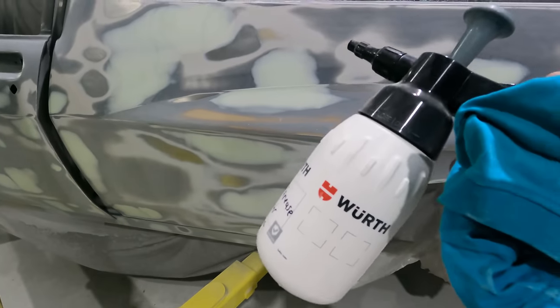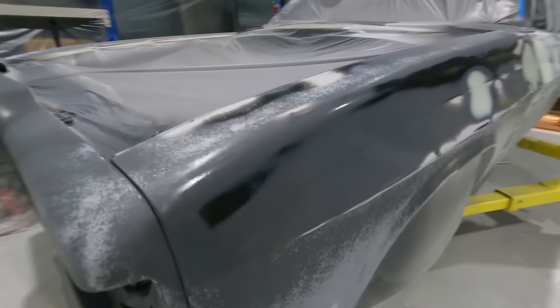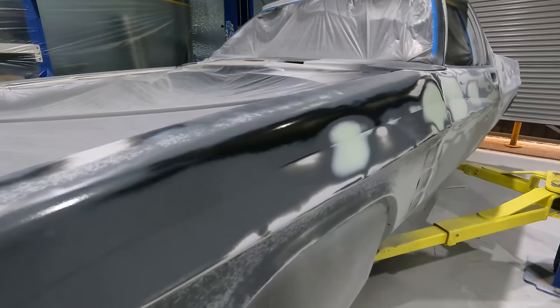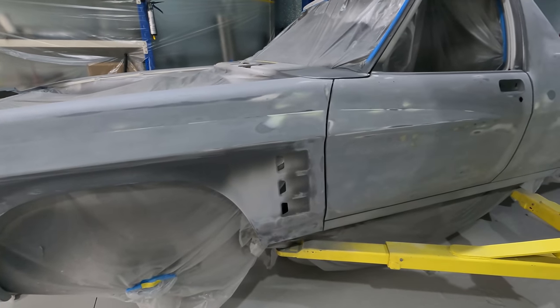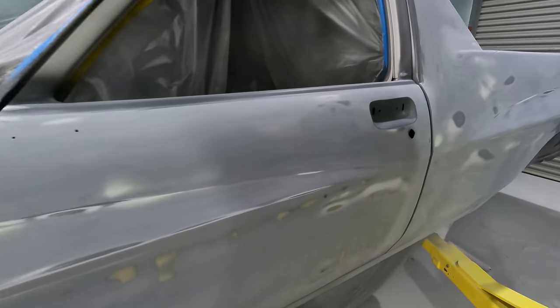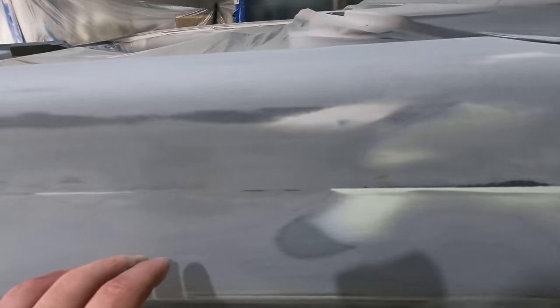There's a neat little trick here with wax and grease remover - you can do this and then look down to see how straight the panel is. I'm going to wax and grease this thing and then put some more all-you-need on and have a look. I've just sanded all that again, I'm going to put one more coat of all-you-need on. It's pretty straight - the top of the doors has like one low spot that'll get covered with all-you-need, a couple of specs, and the line's still there.